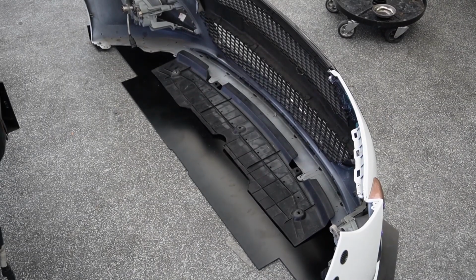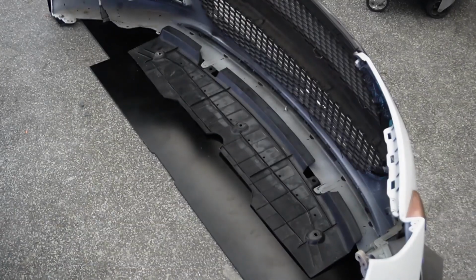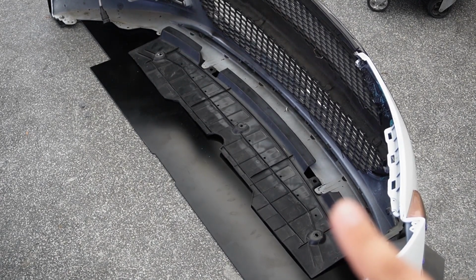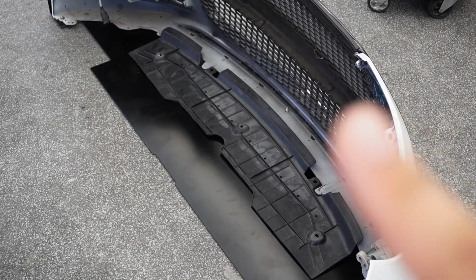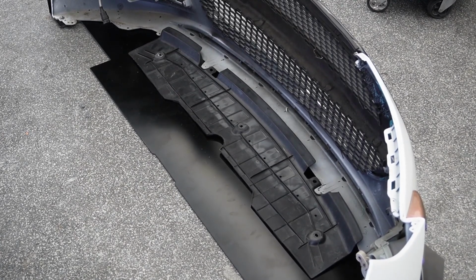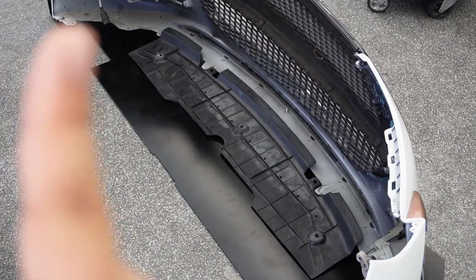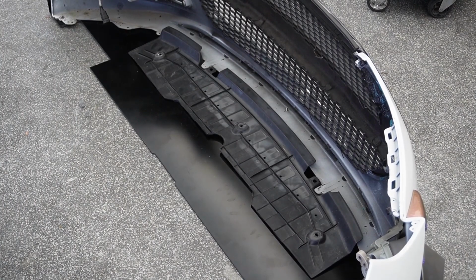So if you're asking yourself how to do this next step as easy as possible, what we did is we removed the plastic trim, which you could see right here. And essentially it actually lines up to the stock bumper. I don't know if you see this little gray tab. This is part of the bumper. And there's actually a specific indent where that portion of the bumper goes into this plastic trim piece. So you can see the indent on both the passenger side and the driver's side over there. And essentially we've put it there right now. So now you have access to all three holes. There's one here, there's one right there, and then the other one is over here. So we're literally just going to make a marking straight down, and then that way you know where to drill.